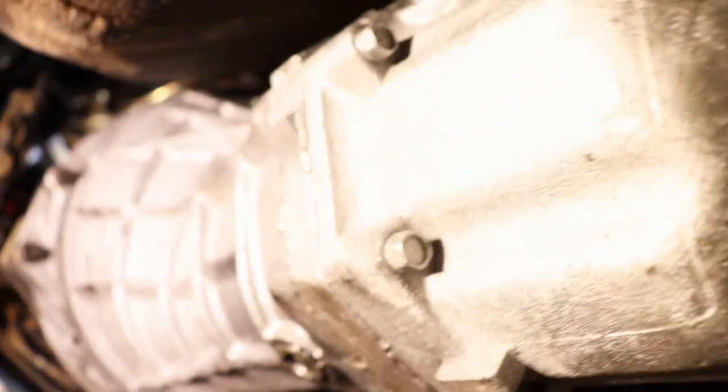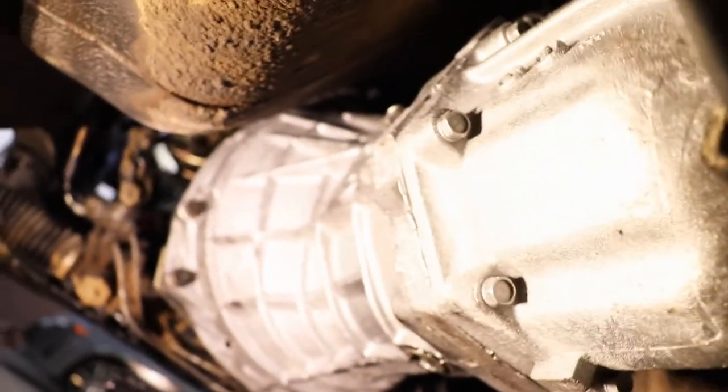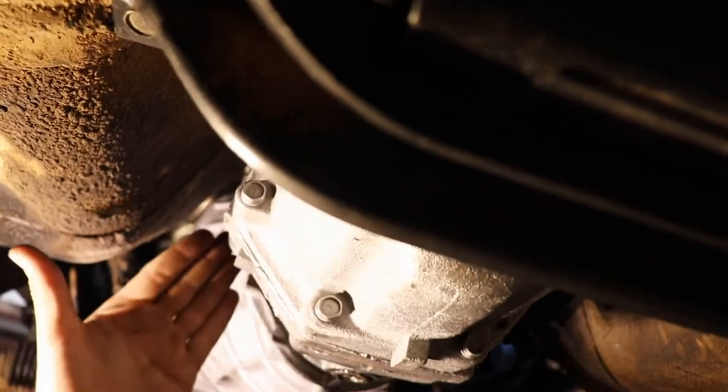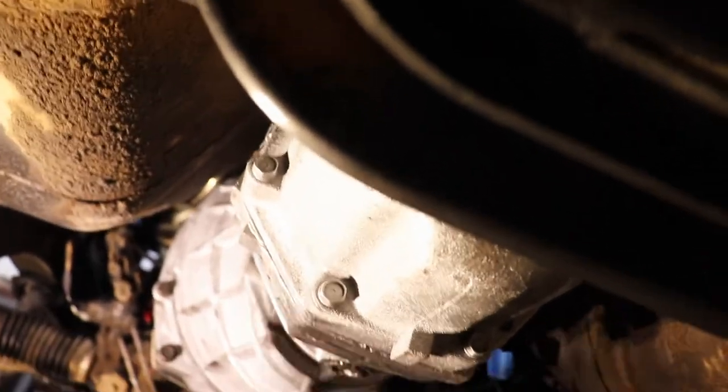I do not want to have to take this mount off, loosen the motor mounts, and drop the trans to get it through the shifter — the amount of room up there is so minimal and it takes so long. So I'm going to see if I can fill it the way it was intended to. There's our fill port, that is where we will be filling the trans — hopefully. I'll have to go get a pump because it's on the side, so without a pump you can't just take a funnel in there. That's not how gravity works.